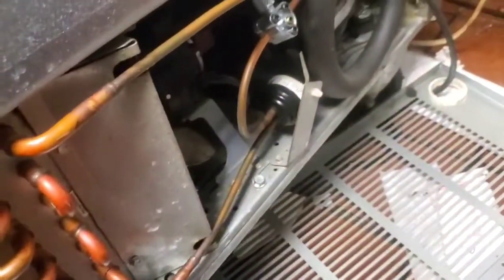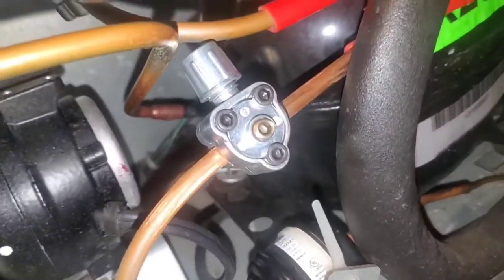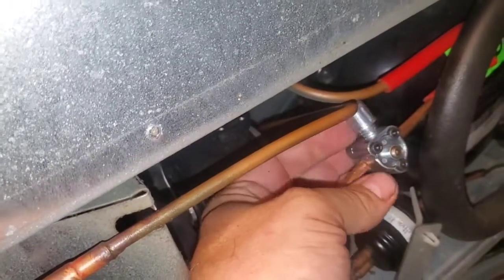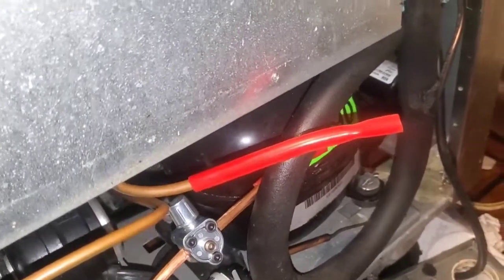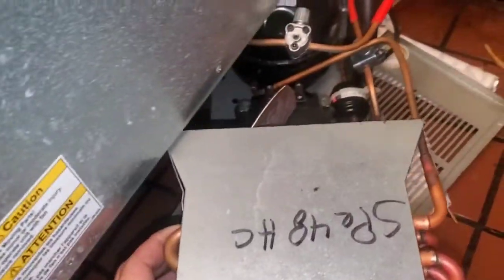This is an R290 prep table. You can see it's been worked on — someone had to put refrigerant in it. There's a piercing valve here on the liquid service stub that hasn't ever been pierced; that valve was never opened. Then there's a nice service stub right here you can easily reach from the side of the unit. So what do I do? Put the piercing valve back there so I have to pull the condensing unit out.